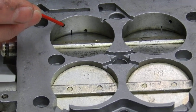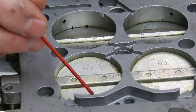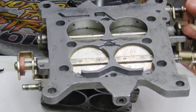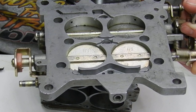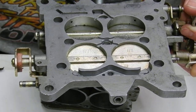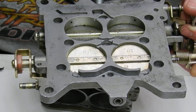When you close it down by drilling these four holes in the butterfly, start off with a 70 to 80 thousandths drill bit and drill four nice little holes. Don't press down hard on it, just take your time. Then if you need more, crank it up and adjust the mixture, and you'll see it start adjusting better.